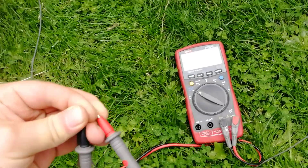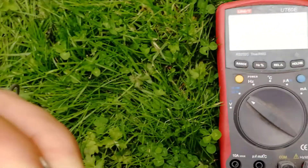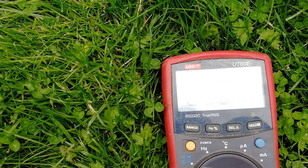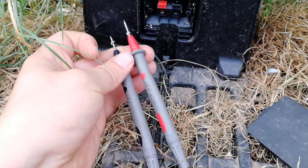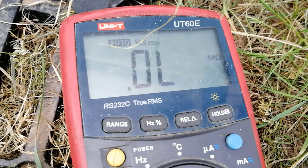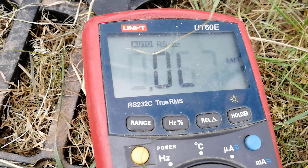With a temporary working piece of cable, I check the resistance, which is none or very low, as you can see. I will next check the proper boundary wire for resistance, and I would expect it to show a low resistance — around 5 ohms possibly, because of the length of the cable. Here we have both ends of the buried cable connected to my multimeter, and I will not hold the cable in order to remove my body as a resistor. As the multimeter is auto scanning, it fluctuates from higher resistance to fully open, which is expected with this kind of high resistance.